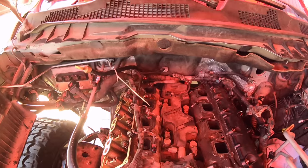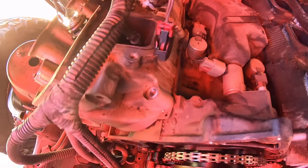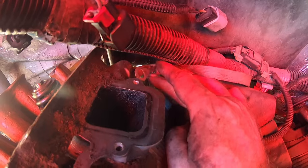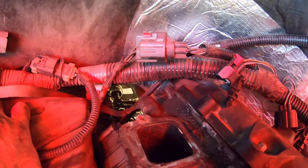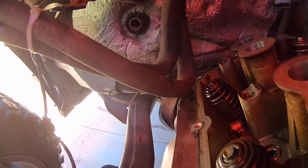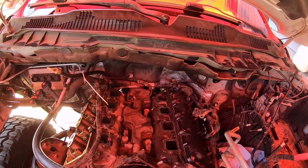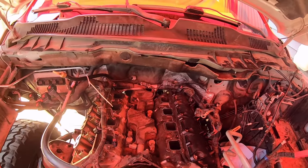Just to confirm: the top cylinder head bolts going across the top — these five are 10-millimeter. Be mindful that there is a 13-millimeter on the passenger side back of the 5.7 cylinder head. There's an eyelet — that is a grounding strap. It grounds the passenger side head and then clips right up there against the body panel. This is going to need repair — the grounding strap from the passenger side head to the firewall connection point is about half chewed through. We definitely want to beef up our grounds to the engine block because bad grounds cause really weird electrical problems.